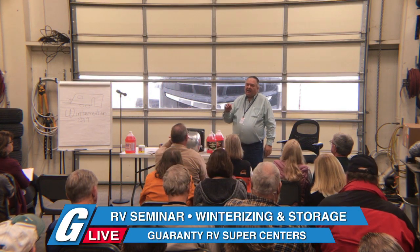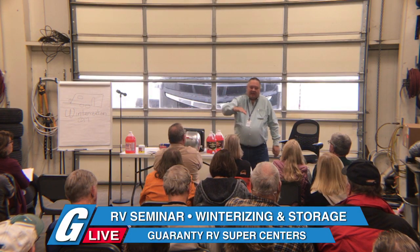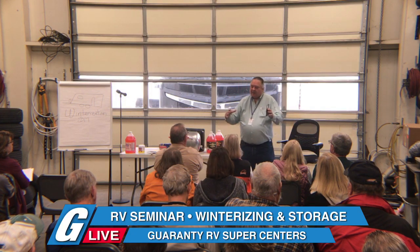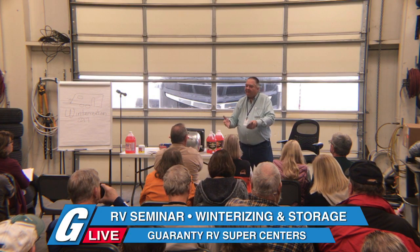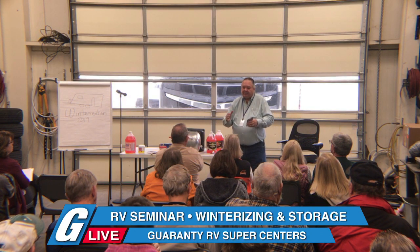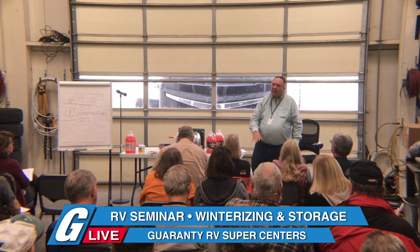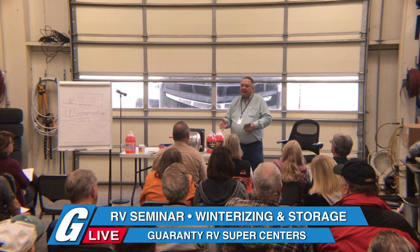We have found that if your coach is not winterized and you have a night where it dips down in the mid-20s, it may freeze, but it won't freeze hard, because by the time the whole coach is down to, let's say, 25, 26 degrees, it's already warming up outside, and it hasn't really been a hard freeze on the plumbing. If it's going to go down to 20 and stay below 20 for 2 days, you're screwed. It's going to freeze solid. You're going to have problems.